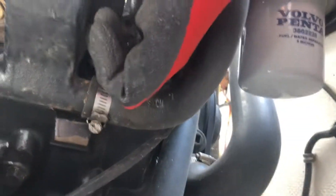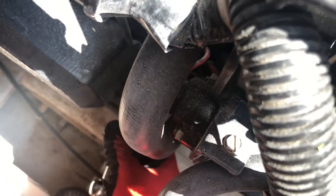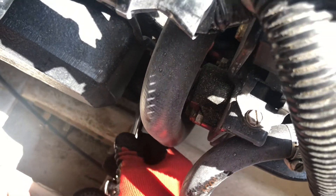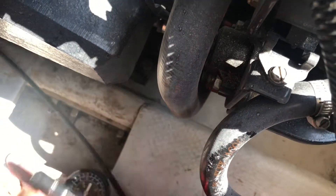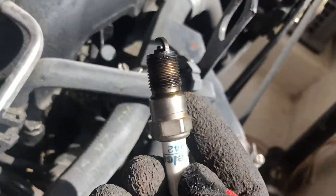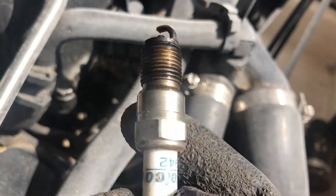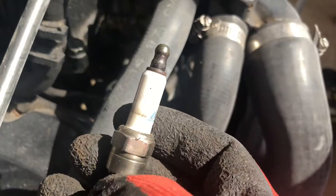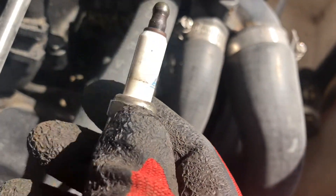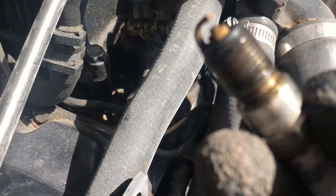Perfect, so there's the first cylinder that I'm going to test. Get your ratchet and socket extension — they shouldn't be in there too tight, sometimes they are — and just remove the first spark plug. And there it is. This is a good time to inspect your spark plugs and see what kind of shape they're in. The gap on this one looks a little bit big; I'm going to have to check what it's supposed to be. I'm not sure if it's even the correct spark plug for this engine, so either way I'm going to be replacing them. Doesn't look like it's in the greatest condition.